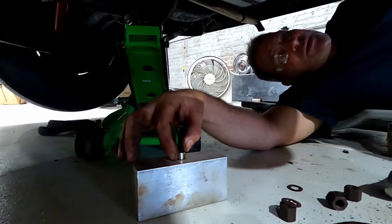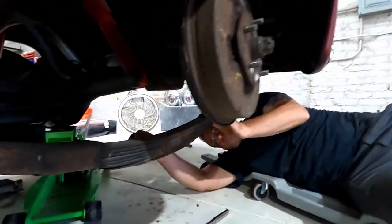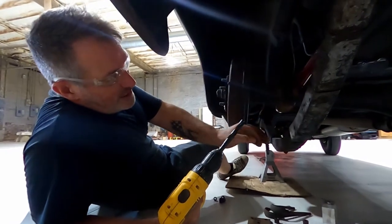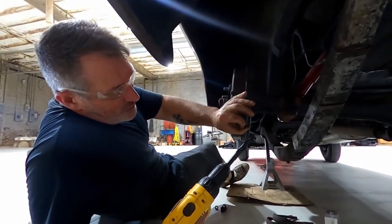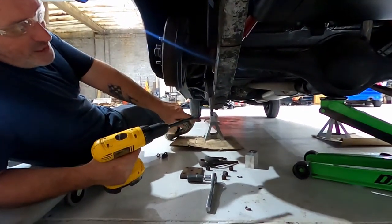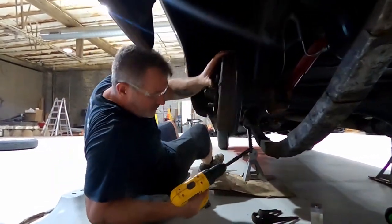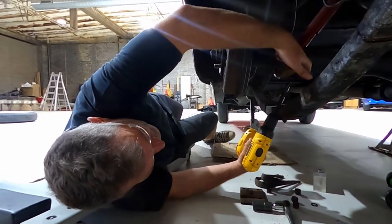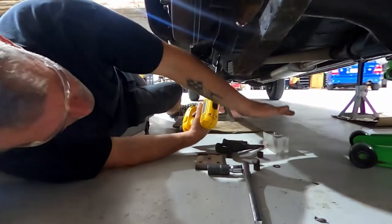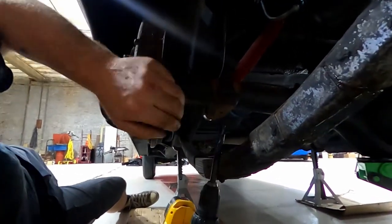It's just going to be a little bit wider than the pin, so we'll have to get the drill out. We're simply going to drill the hole in the axle pad to a size slightly larger. This is a 9/16-inch drill bit — just over a half inch on the cap screw — so that'll open it up enough to seat in there properly. It should drill through the hollow to open it up, then the axle pad will sit on top of the block.